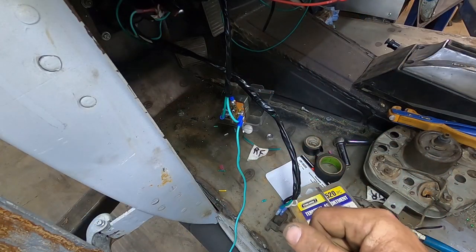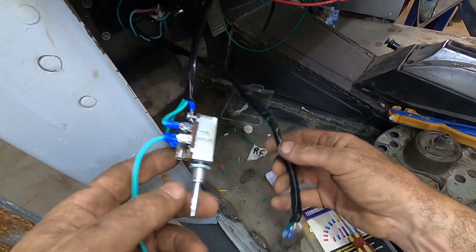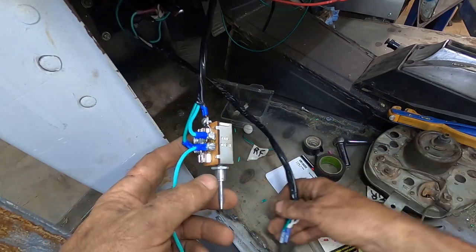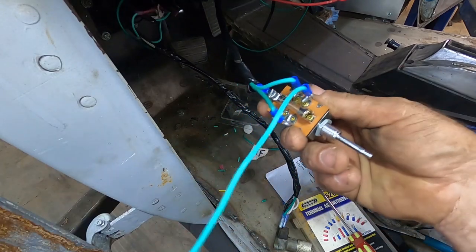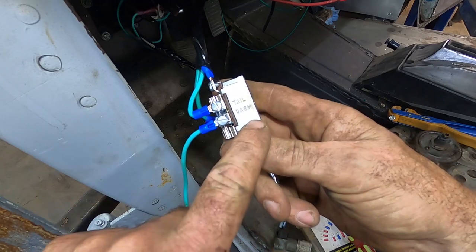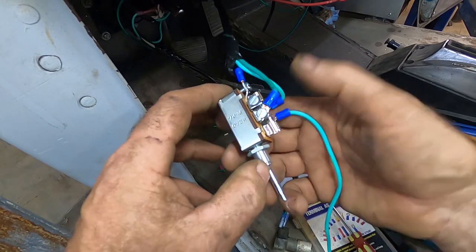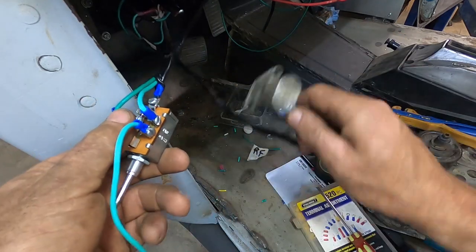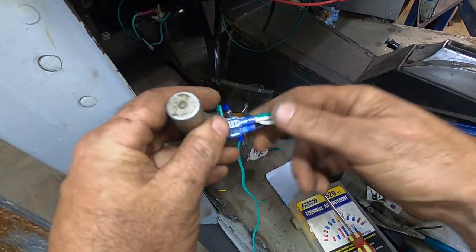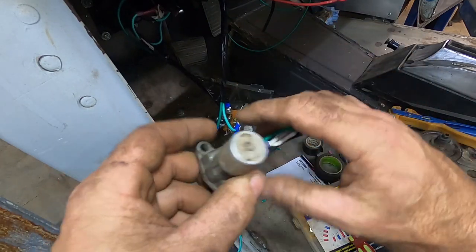All right, we got our basic wiring done. We just ran cords front to rear. Show you that in a second. I went to our Canadian Tire, got us a headlight switch, which is nice because it says taillight, dash, headlight, park. So your headlight wire will run to your dimmer switch, which then runs off to the wires I ran over to the headlight.